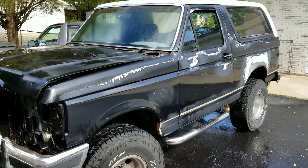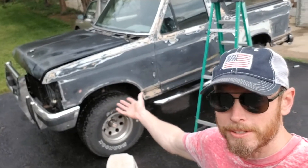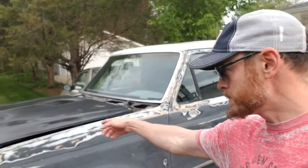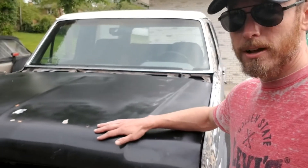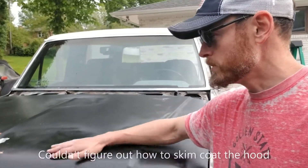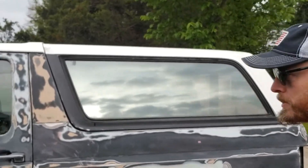It's going to look so much better than it did, so you can't complain too much. Good morning, another beautiful day in Tennessee. Continuing work on the Bronco — yesterday I ended up going along and painting the entire sides of both panels and got it all touched up nice. This area probably has the worst sun damage, so I'm going to end up taking the angle grinder to smooth it out and try to get all the rust off. I'll probably try to do a quick skim coat of Bondo to make it more uniform. There was a lot of sanding on the other side, hopefully this won't be as much since it's not nearly the same surface area. I'll also be working on the top of the vehicle.